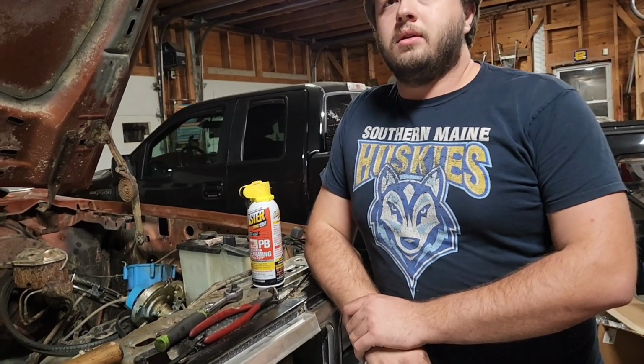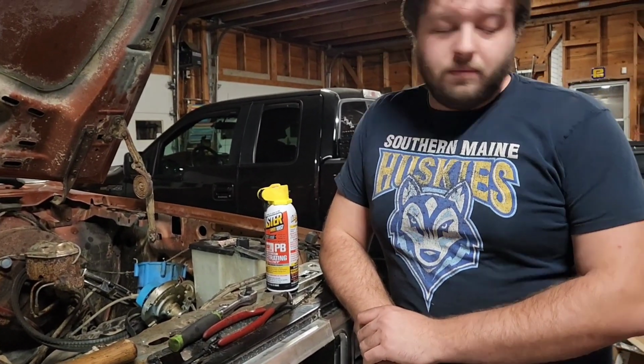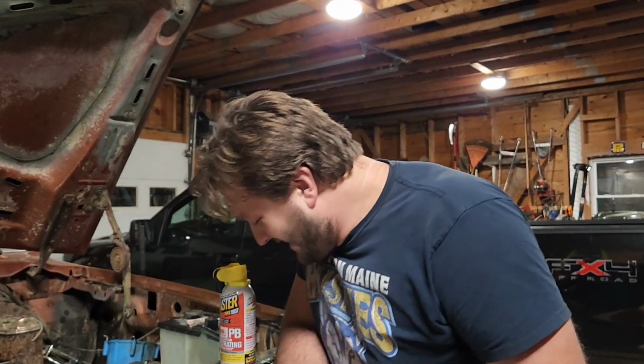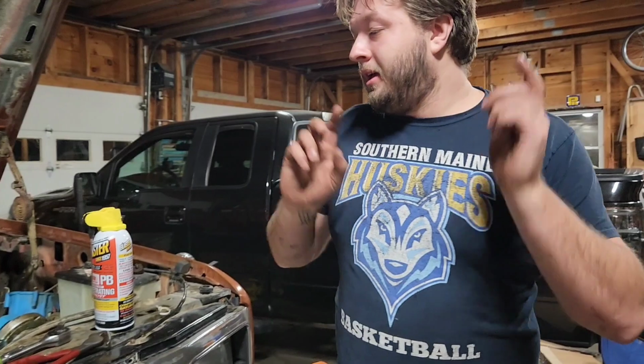Another thing too, make sure you take the air hose and blow them out, in case you have any chunky oil or carbon buildup. Those things are dry right now, so I'm just gonna. It's a tiny hole. I think my lungs have enough pressure. You just blow. All right, but yeah, so those will be going in.